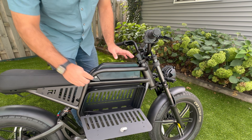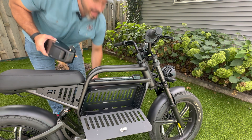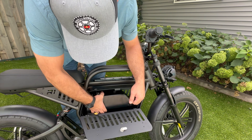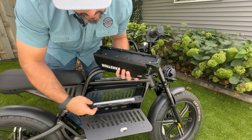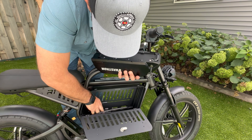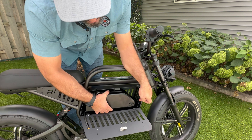Now we're just going to test the batteries. I'm going to remove the factory battery — no battery — and then take this second 52-volt battery and put it into the cage. Ideally you would want to get a solidified mount right here so you could slide the mount off of the battery. The bottom is narrow and you won't have the room needed to slide the battery out. If you want it mounted permanently, you're going to have to make a lift so that the battery sits more central from top to bottom so you can slide it off the rack.